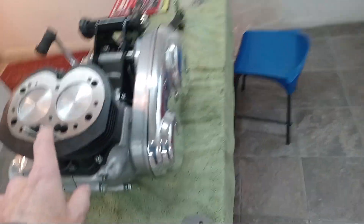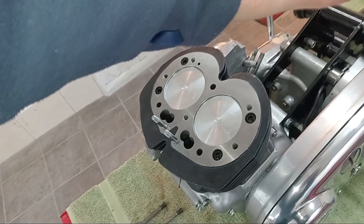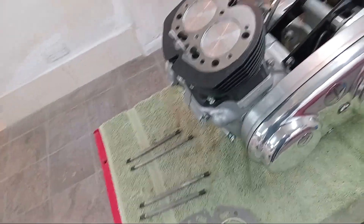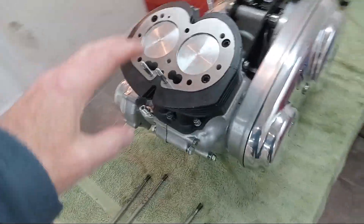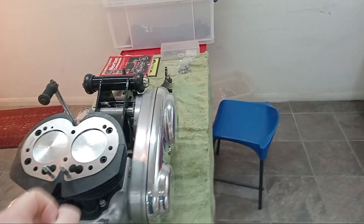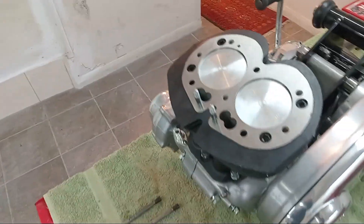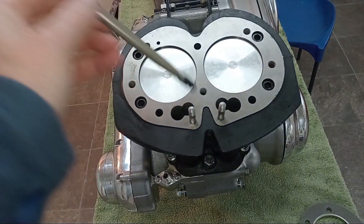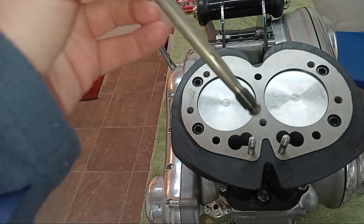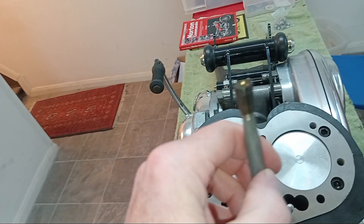The plan is to put well seal on the mating faces, put the gasket on, then put the push rods in, and lower the cylinder head on. We have the advantage of no frame above the head. If the engine were in the frame, you'd have to stuff the push rods up inside the head to get clearance, then get the head under the frame and lower everything down onto the barrels.